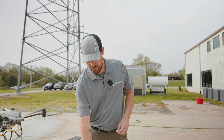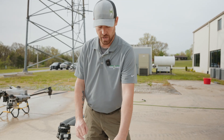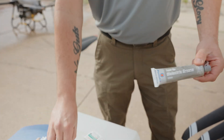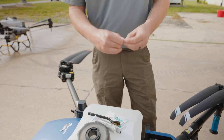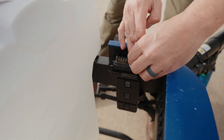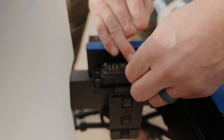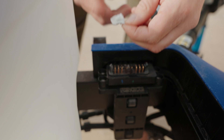So we're going to go ahead and first, if you guys get a field ops kit, all this will be included. We have alcohol wipes, dielectric grease, some brushes, and then there'll be a few other things there. So the first thing we want to do is take some of our alcohol pads and go down through the terminals and start cleaning them up.